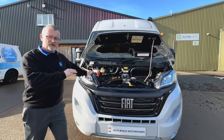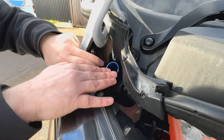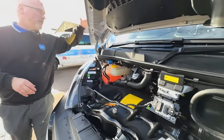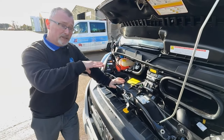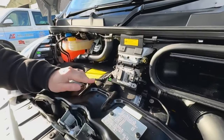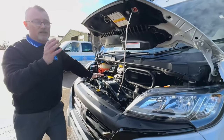I'm not going to go into too much detail underneath the bonnet, but there are certain things that are advantageous to know. Just here is your washer bottle fluid - it is quite down low but if you slide it out it makes it easier for access. As for the rest of your fluids, you do have to undo these catches and take this piece off to gain access. Don't worry about dipsticks - that is done on the dash, which we'll show you when we go into the cab. The main reason I want to show you underneath here: if you have a flat battery, the battery is underneath the floor pan under the passenger side and it's a nightmare to get to. So if you want to jump the vehicle, your negative just sits on there, and just down here there is a catch - pop that up and that is your positive. Negative and positive on there - you jump from underneath here and it will save you cutting your fingers to pieces.